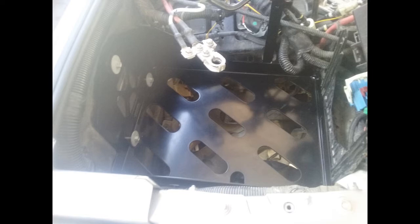I'm showing this method instead of showing the drilling, sawing, and cutting live. I've already removed the stock battery tray here. I didn't do it per the instructions — the instructions have you pull out the entire battery tray, which is attached to the platform that supports all the way down to your air filter. But because I have an aftermarket snorkel, I kept the fuse box and the connection to the air filter all connected.